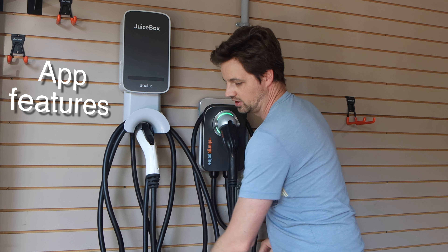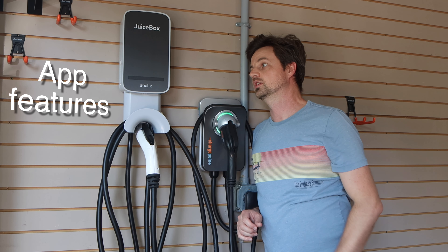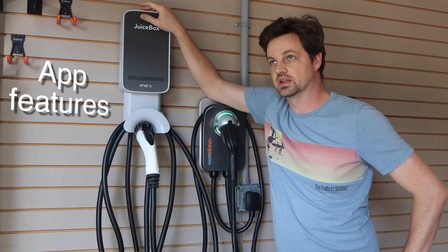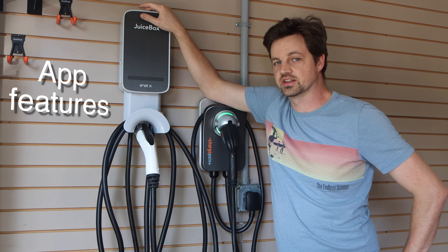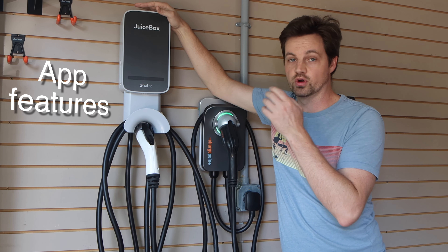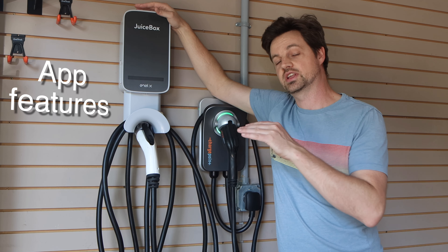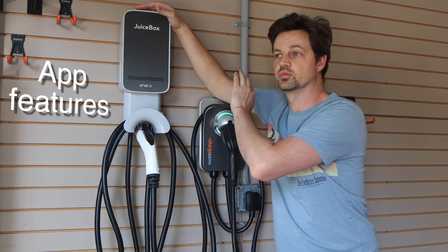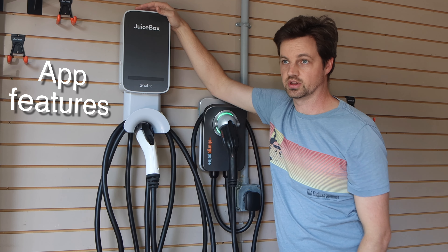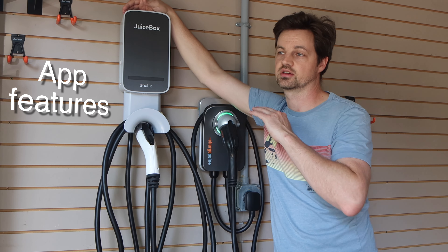As for the JuiceBox app: they do not have a widespread charging network, so if you have an Electrify America app and a ChargePoint app already, you're going to need another app to control this thing. The setup was a little bit quirky. This one has a little bit more features in its app but it's not as polished. One thing you can do is specify in the app what amps you want it to charge at and you can alter it in single digits — 40, 39, 43, 48 — and it will stay at that so you don't have to reset it every time. It also has time of use — you can put in your hours manually, or give it your address and it will take your power company's rate plan and do time of use accordingly. It's got detailed information for every charging instance, like how much power was used and how long it was.